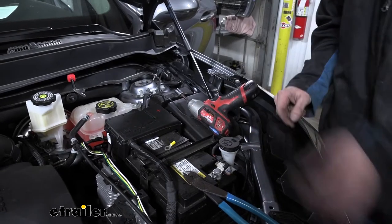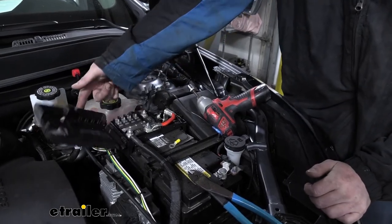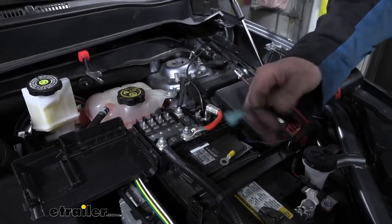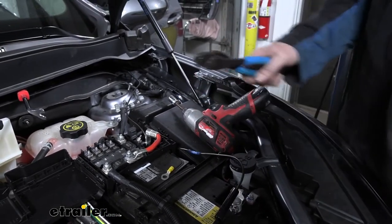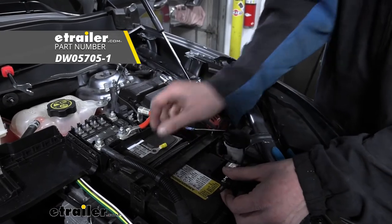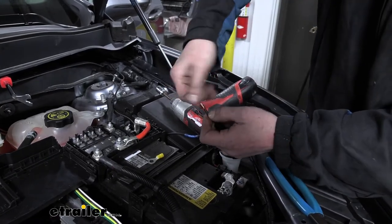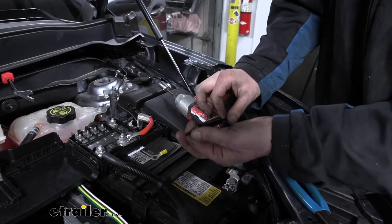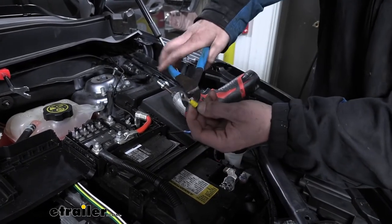We're going to connect our power source to our battery. There's a release tab on this side — lift up on that, and there's also one in the back — lift up on that and it'll flip open. We're going to attach it to the post located here, but your wire has a spade terminal that comes pre-attached to it. We're going to cut that spade terminal off because it doesn't have a way to attach to the battery, and then we can attach a ring terminal — also available at eTrailer. The easier way to do it is just cut off that female spade, slide on a ring terminal, and crimp it on.